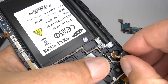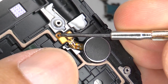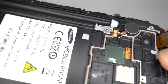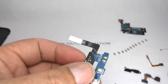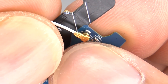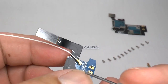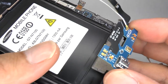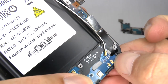So to reassemble, place your vibrating module into its hole and gently push that circuit board down onto that little pin there. Make sure that's pushed fully home. To replace the 3G GSM antenna cable, start by plugging it into the micro USB and microphone board. Line that up and snap that down into place. Bring the cable around to line up with the white lines on the ribbon, and then offer this into the bottom and give a gentle push where the double sided tape is to make sure it's stuck down nicely.